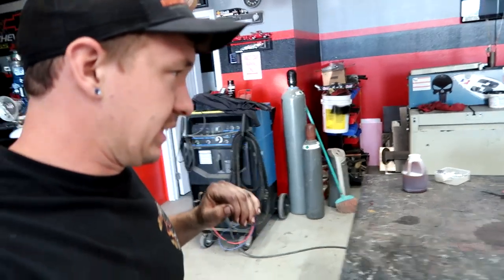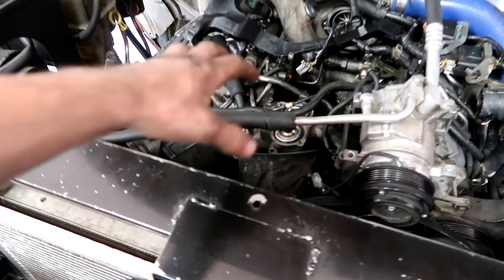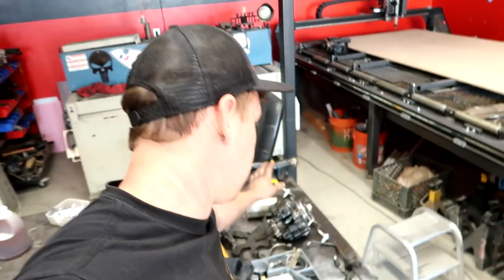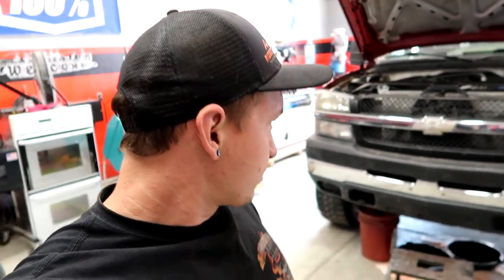After some fighting we got the CP3 removed from the truck. We did end up having to pull the front AC and alternator mounts off and pull the coolant crossover tube forward a little bit — kind of a pain, but it's pretty much the only way out. Just plan to do it, don't try and work around it. I knew better, I just thought I was being sly, but after about 10 minutes of fighting I just did it the way I've always done it. We're waiting on parts — got new fuel lines coming and the new CP3 on the way, should be here Friday. That leaves us cleaning up for today and going outside to move some stuff around with the big truck.